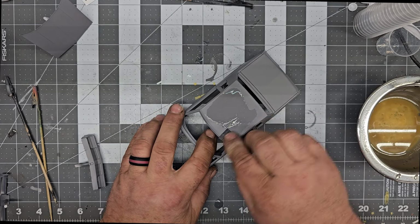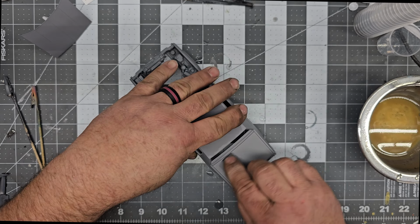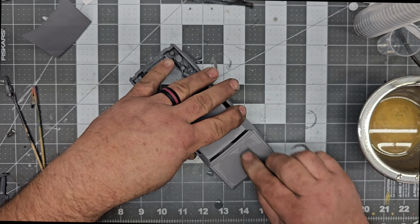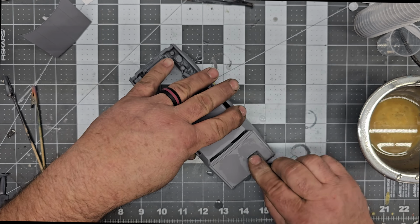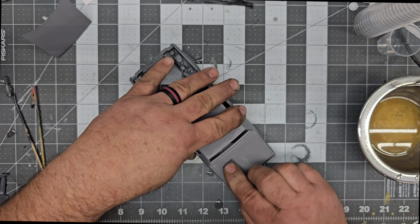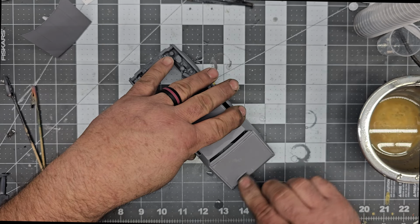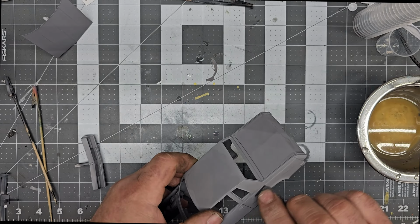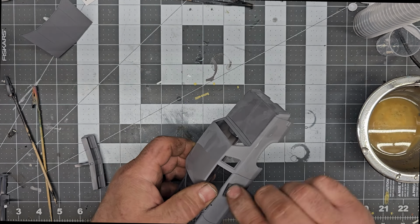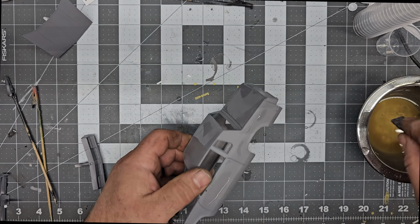It sprayed out pretty good. I don't think I had too much debris in this, thankfully. I think I had one spot in the trunk, if I remember right, but see, we gotta be careful. Now, I'm not putting a lot of pressure on it, it's just enough to make it happen. Like I said, this is only 5,000, so it'll take a lot to actually go through something, but it won't take too much. So being this is lacquer, we can get right on this right away. Obviously, if this is enamel, we'd have to let it sit for a few days, and go from there.